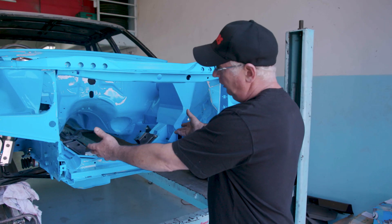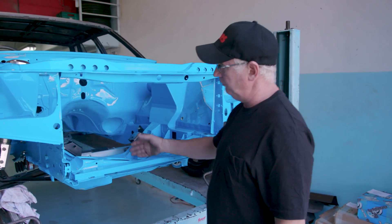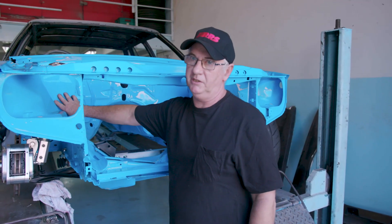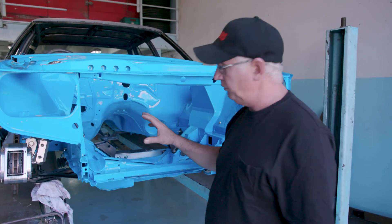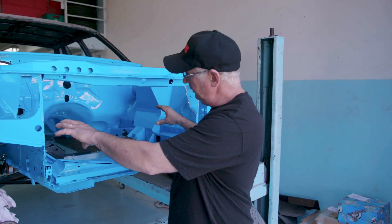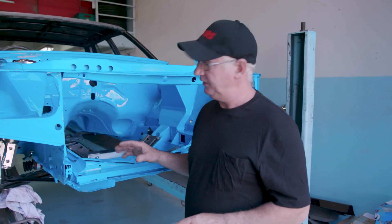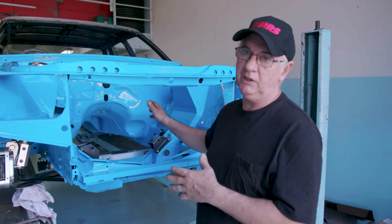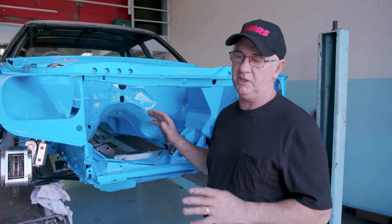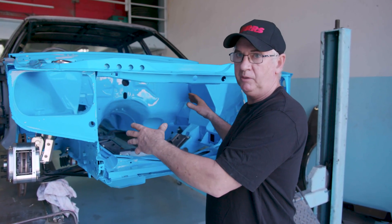This in itself has no detriment whatsoever to the chassis because of the changing chassis dynamic loading from our strut front end conversion — this is a really important feature. We've also got our rack and pinion, which changes certain loading on the vehicle but more importantly provides better steering. And we've got our three-link rear suspension, which totally changes the chassis flex because of the way it reinforces and changes loading points.